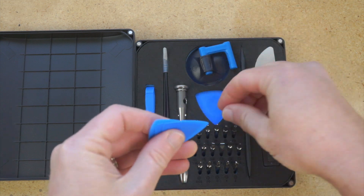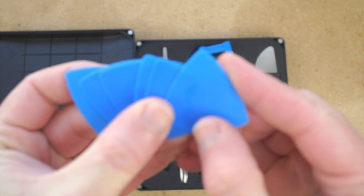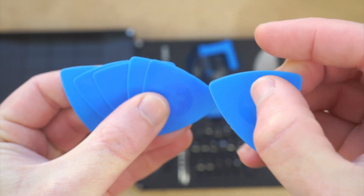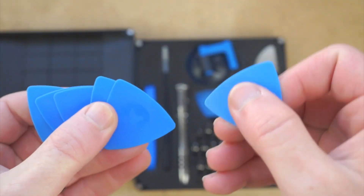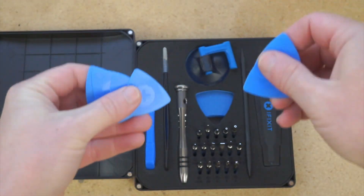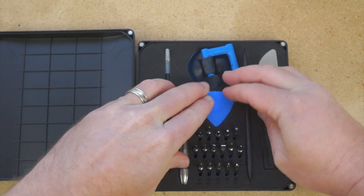These are funny — as a musician I know that these are clearly based off of a guitar pick. I think they even call these opening picks. They're just thin little pieces of plastic that you can wedge in the sides of a device to get at the glass you're trying to open. You wedge a bunch of them — it's almost like acupuncture. You just put a bunch of them in around the device to wedge the glass, and eventually with the help of these and the suction cup tool, you can pry the glass off the front of your device and get to the electronics inside.